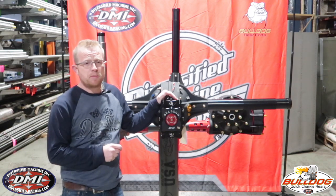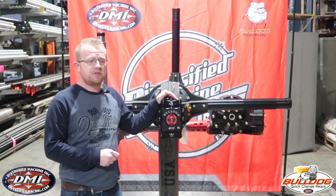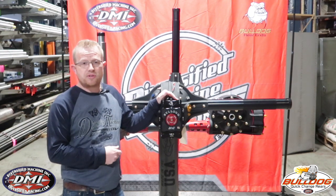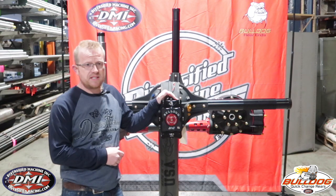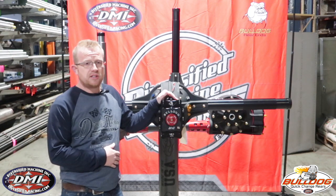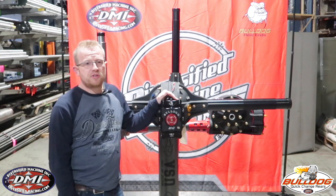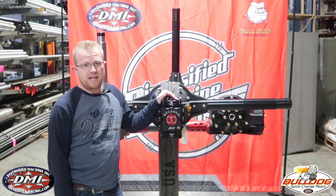Our suggestion would be to look at ProGlide treated bearings. We use the ProGlide treated service here. We've used other services throughout the years — Micro Blue, RF 85 — they all provide good service and do have a benefit in reducing friction and also running cooler. We choose to support ProGlide because they are a local company here in Pennsylvania. We will see bearing life increase as well as lower operating temperatures and friction reduction if using those bearings. So if you're looking for some way to possibly get an edge on your competitors, we would highly recommend that in a lower horsepower or even a higher horsepower application. You'll see the same benefits. We'll see you next time.